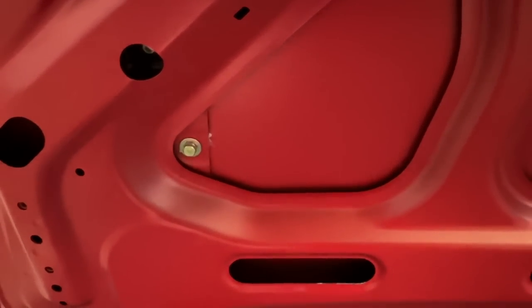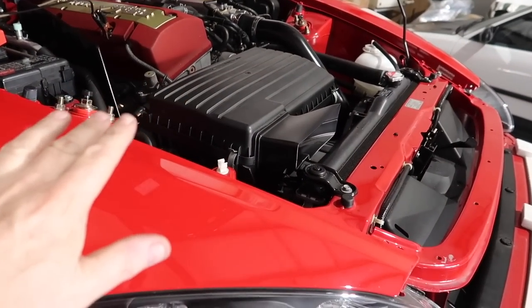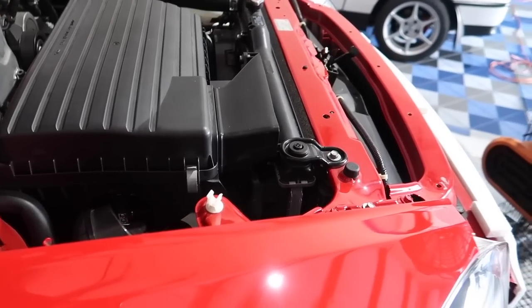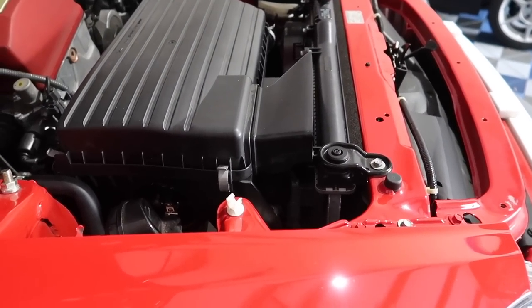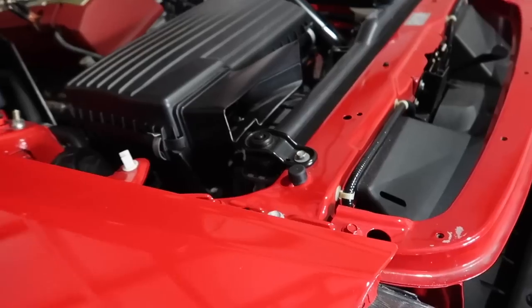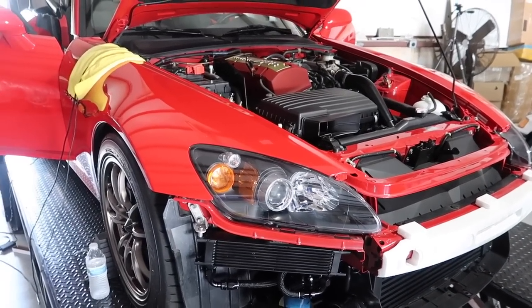That's the thicker bracket that's actually welded to the trunk — that's another reason you should get the CR one. Back on the dyno — I'm leaving the airbox closed. I don't want to do any more airbox testing; I'm happy with it. It didn't pick up any more power with the lid off, which means our second hole is working. It has the inlet right there, so let's get up to temperature and do some pulls.